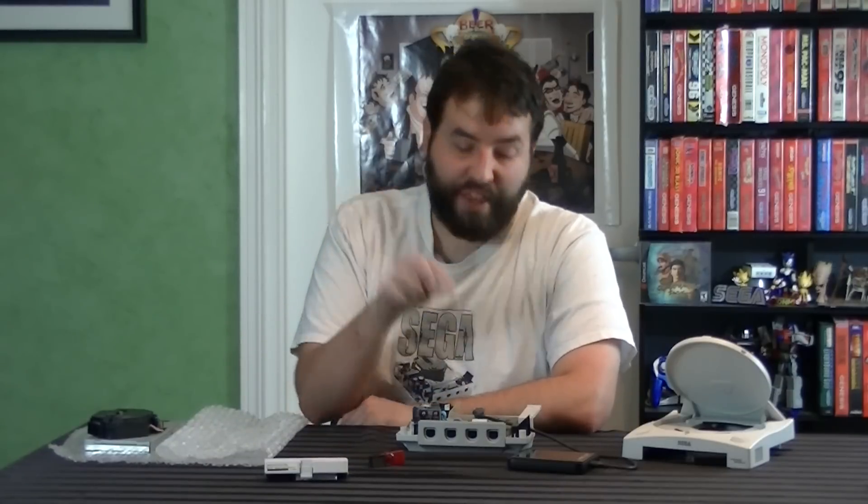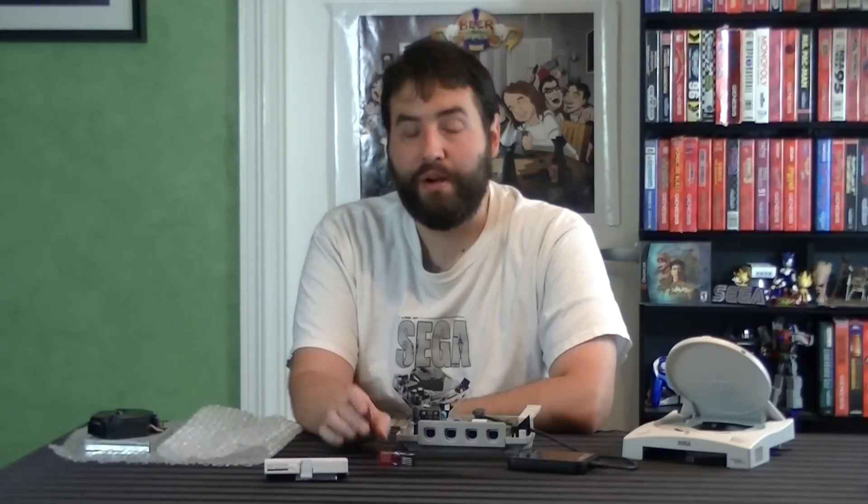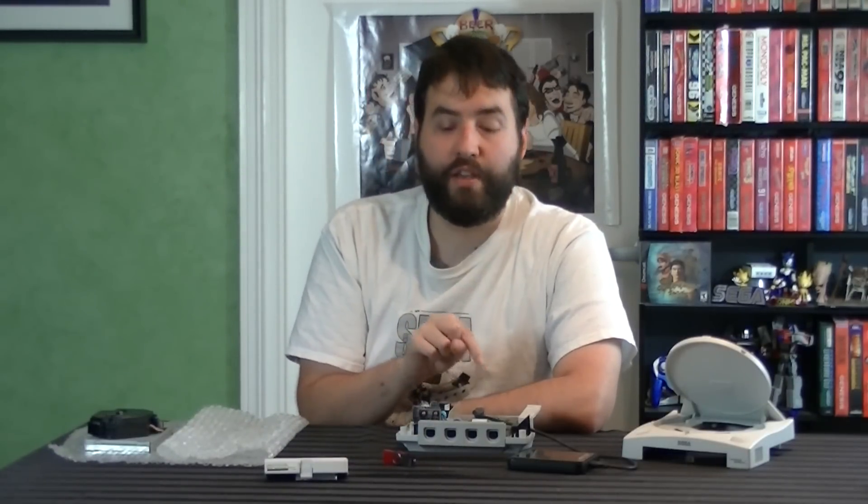Load times. Load times on this thing are generally pretty good — that's kind of the best way I can put it. With the GDMU, it's limited to only SD cards, and only certain SD cards at certain sizes and of certain production — meaning SanDisk and a couple of brands that work. So therefore there's really not much variation in load time speeds. It is universally agreed that the load times off of there are better than they are off the disc. With this thing, because you can stick in just about anything USB-based, it's going to depend entirely on the quality of your flash drive or your hard drive. These speeds can vary. In general they run just fine — in general they run better than they would off of a disc. But the nicer your flash drive or the nicer your hard drive, the better it's going to work. With that in mind, this is a USB 2.0 device. Don't bother getting 3.0 devices for it — they are technically compatible, but they really won't take advantage of the 3.0 functionality, and in fact there can be negatives to that. 2.0 devices seem to have no issues booting games, but a lot of people have reported that 3.0 devices generally work but every once in a while they just don't.